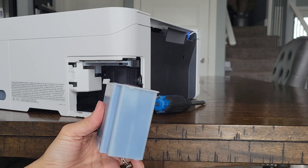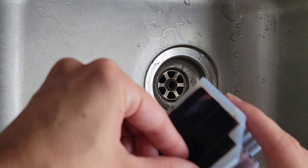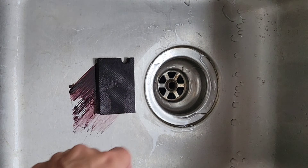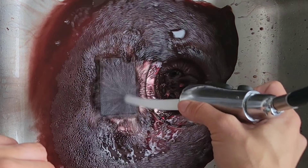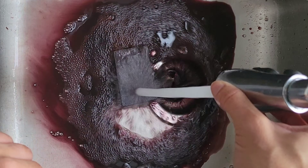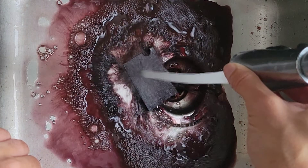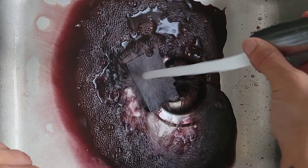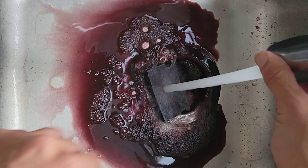As you can see, it's all full of ink. You might want to put gloves on — there's going to be a lot of ink in there. Go ahead and pull those pads out and wash them up, continuing to wash them out until the water starts to run clean. Once you're finished washing them, you're going to want to let them dry — typically at least a day, since they do take quite a while to dry because they absorb so much liquid.